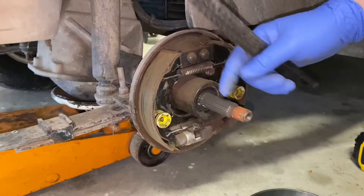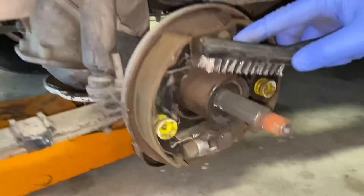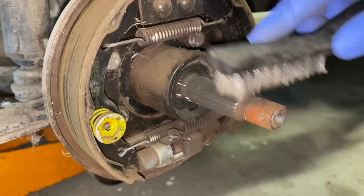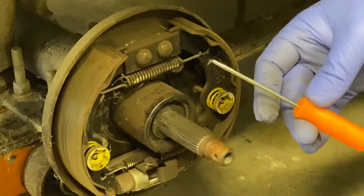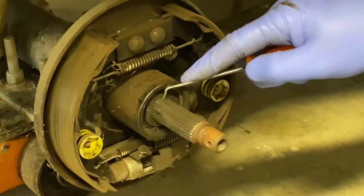The splines are actually full of metal, so I'm taking a wire brush — zoom in and look at those splines, that is just metal debris. I'm blowing all that dust out of there. You can also get these little picks from Harbor Freight for about 99 cents for four of them — it helps you get in these little grooves, just flaking that metal out of there. Make sure you get all of it out, because if you don't, the new grooves aren't gonna seat properly and you'll have the same problem all over again.